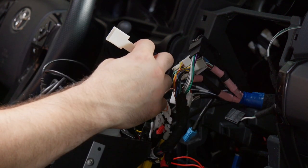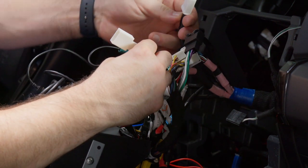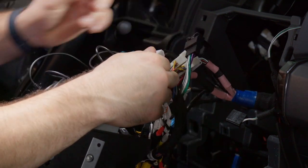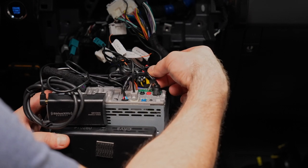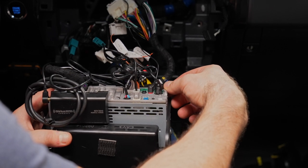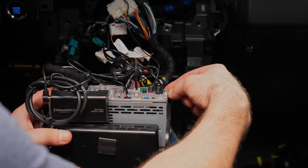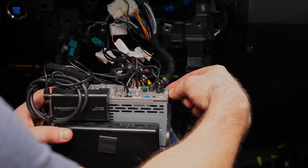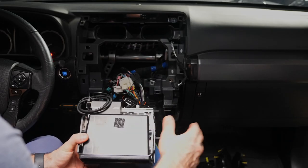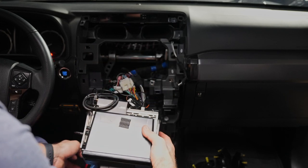The next connector we're going to plug in is the antenna, which is right here from our bundle, and its mate is right here — so we're going to plug that in. Now we're going to put in the mic, which we've already ran. I'm going to put a card in the upper right-hand corner of the video which will link to the video showing you exactly how to run our microphone to the factory mic location in your Toyota 4Runner. So we have all of our connections made, and now it's time to put the body into position so that we can run a test.